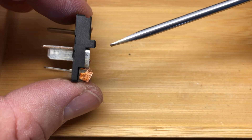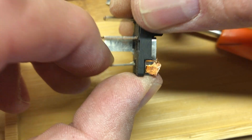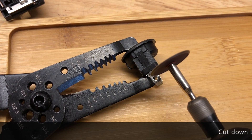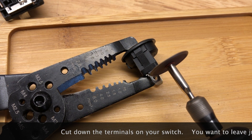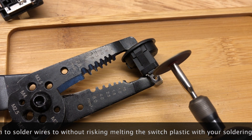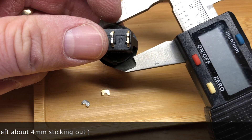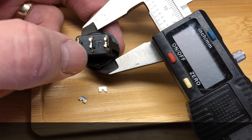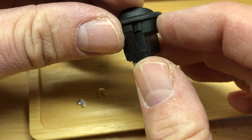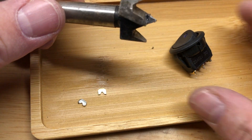That is what we're left with. One of my pins is a little distorted from all the mechanical action — that's going to straighten up nicely. My switch has a 20mm bezel for mounting plus a couple of ears. I have a 20mm drill. What I'm going to do next is put a hole in the top of our relay housing. The easiest way to do it without breaking the plastic is to have it flat on a piece of wood and go through from this side.